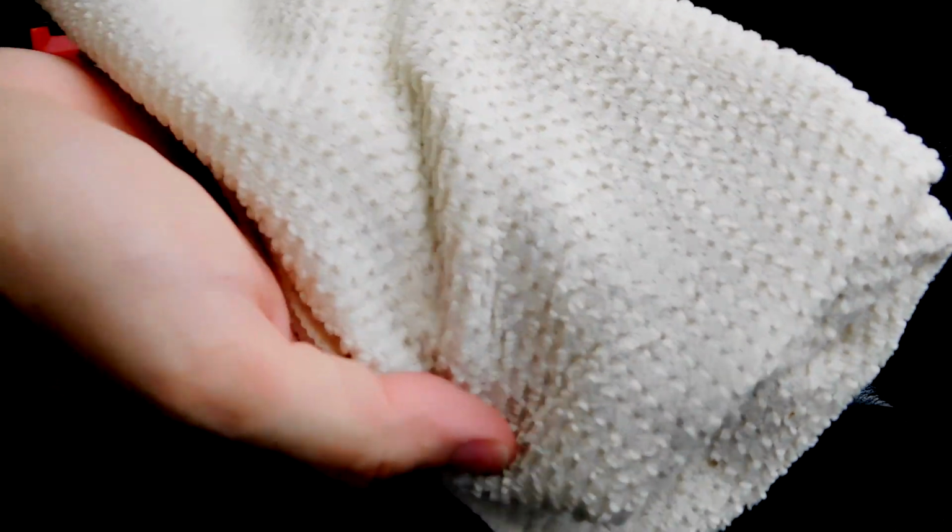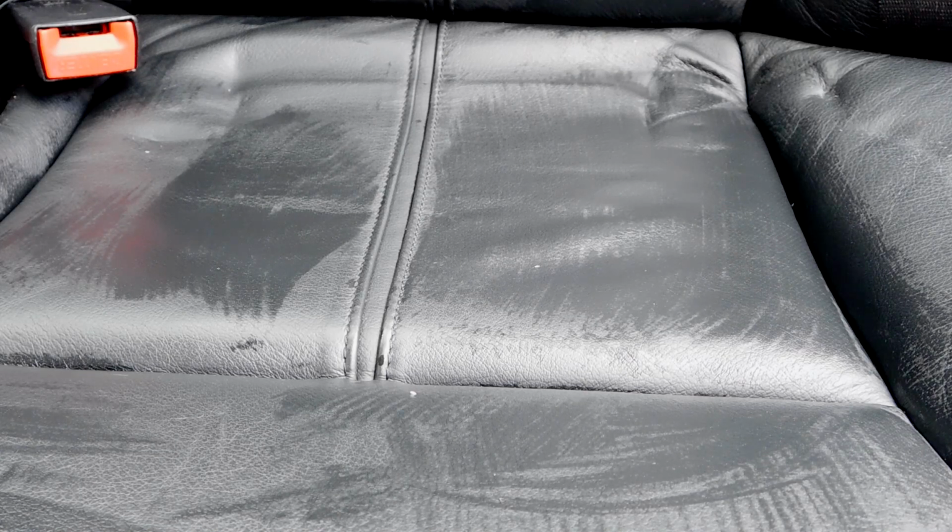But I build a glove box kit. I always have a bit of a cleaning kit in the car anyway. If you were looking at minimizing the pieces that you needed to carry for that, I would say the towel paired with the cleaner will work an absolute treat just the same. Like I said earlier, good clean leather should have a real nice matte finish. So just time lapse this part. You can see it dry out and dry to a nice finished end product.